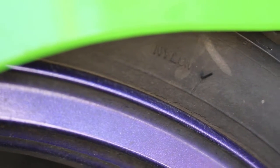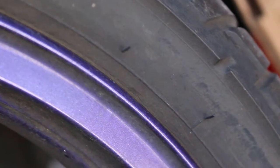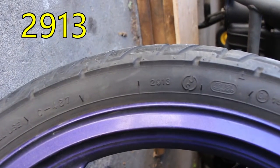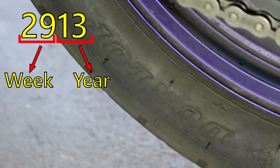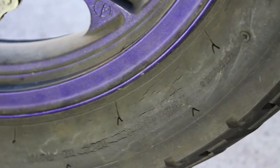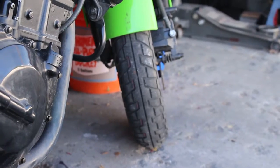So this is the reason I'm going for new tires. This is the crack on the front. The fronts actually aren't that bad, surprisingly. Both the front and the rear have the same date code — 29-13, which I believe is the 29th week of 2013. These back tires, however, are in very bad shape. The cracks are pretty deep, and it just really wasn't safe to ride anymore. Since they both have the same date code, I thought it would be best to replace them as a set. Also, that front tire is awful skinny.